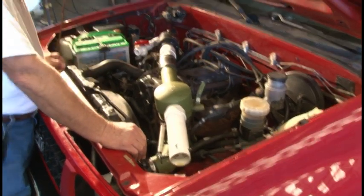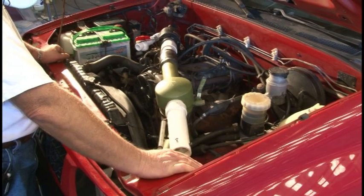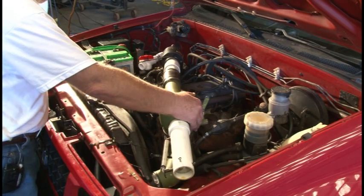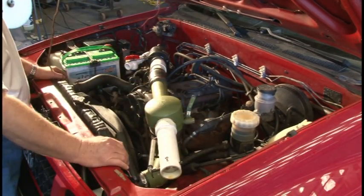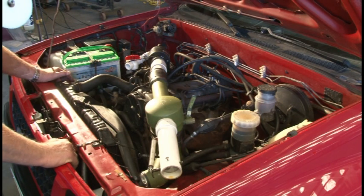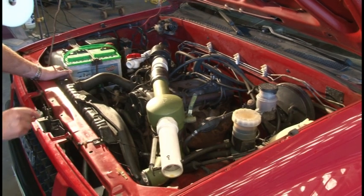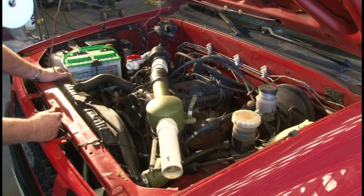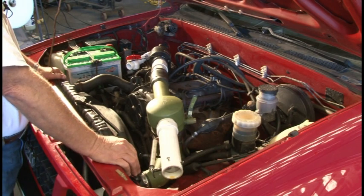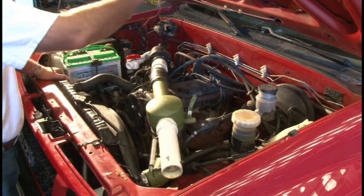With the exception of the electric fuel pump, which you can buy at the automotive store, the entire system works like this: this is your primary bottle — gas pumps up to the bottom of that bottle, gets to a certain height, and then feeds into a tank I placed in front of the radiator. In the bottom of that tank there's a sump, and I put a pickup in there and pump the gas back to the main fuel tank. I've taken the intake line from the motor's fuel pump and run it into here, so we're making one big circuit.